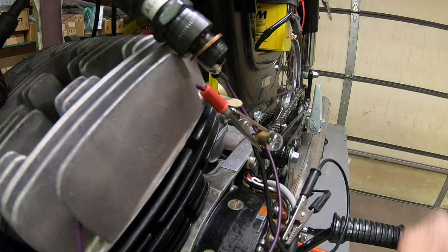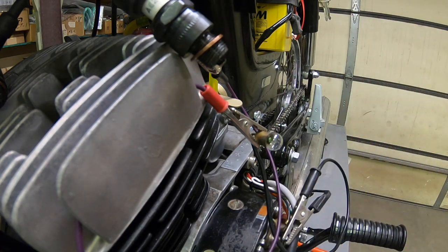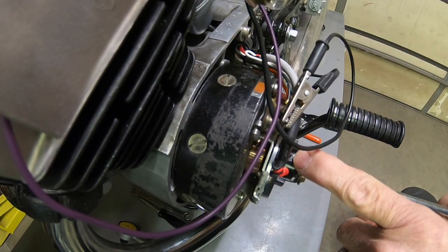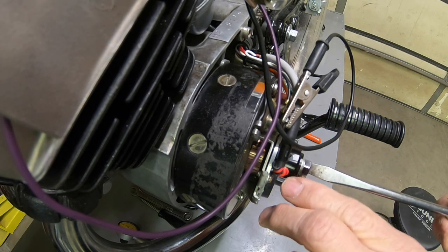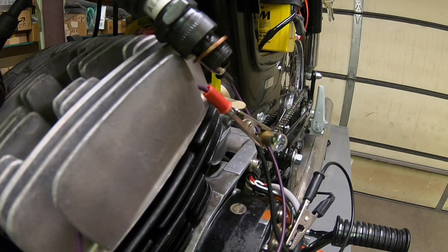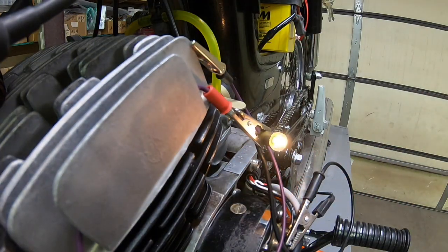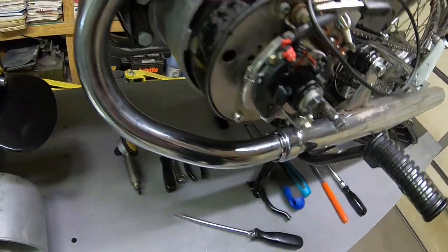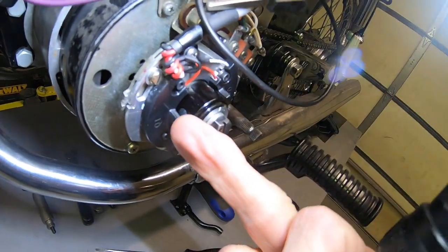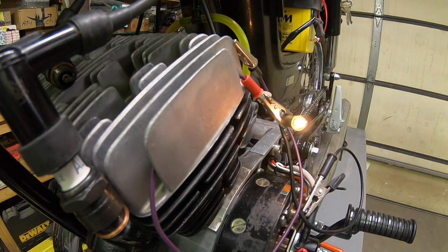Okay, we're going to power on, and I'm now going to bring — I'm going to be going in the direction of engine travel. The magnet is right here. I'm going to bring it over to the sensor. Okay, spark plug right here. There it is. And again, our magnet just coming into the sensor here, the left side.